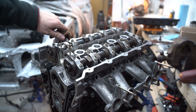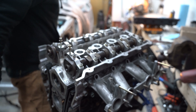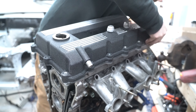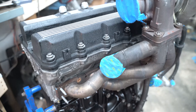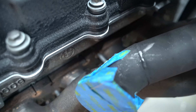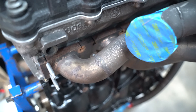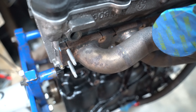I'm going to temporarily put my valve cover on to keep everything protected. Just test fitting the turbo manifold, I found that I have one, two, three, and four studs that are too long and they hit the manifold. So I'm going to have to find a way around that — I'll probably just get stock ones, or maybe try to find some shorter E90 ones. I'm not too sure.